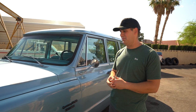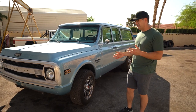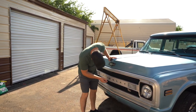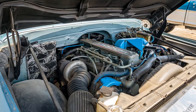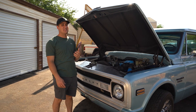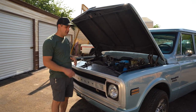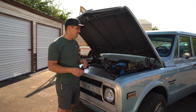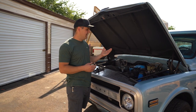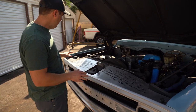You'll notice the front wheel isn't centered in the fender well — that's because this truck is sitting on a 1995 Dodge 2500 chassis. That's the whole reason I bought it: it comes with a 12-valve P-pump Cummins. This truck runs and drives like an absolute bat out of hell — fast, builds boost, makes whooshing noises, and the turbo flutter when you let off is really cool. It has a 47RE transmission right now but it's two-wheel drive, and we're going to make it four-wheel drive, so that transmission will have to go. We'll do a new transmission controller and redo all the wiring.